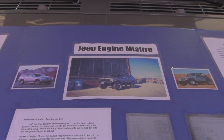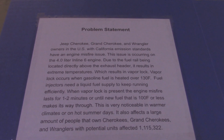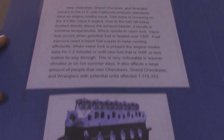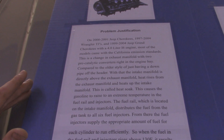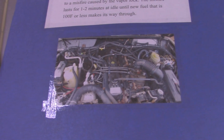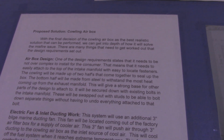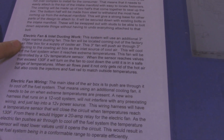I did create a poster here because it was for my engineering class during my senior year of high school. I have a problem statement — basically it's on all the Jeeps that have the 4.0 after 2000 with California emissions equipped. I stated that when the temperature in the fuel system reaches over 130 degrees, vaporization starts to occur, and once you start up the vehicle, a misfire will start to occur. Then over here is my proposed solution of the Cowling air box — I explain how I designed the air box, and how the electric fan and inlet ducting work, and the electric fan wiring.